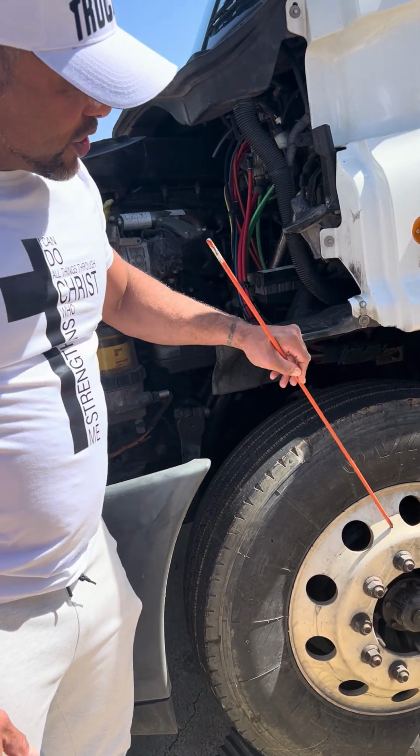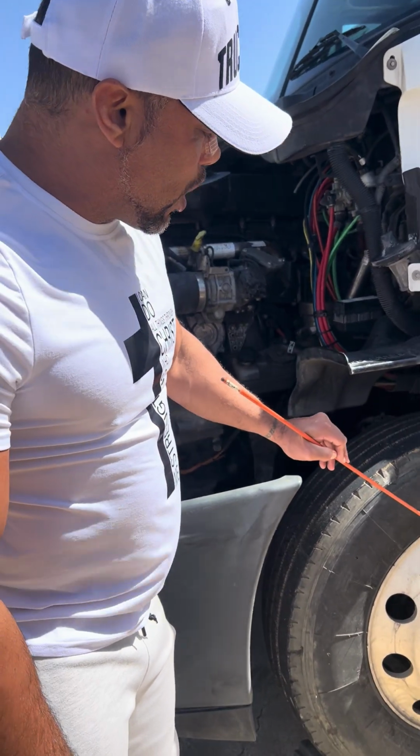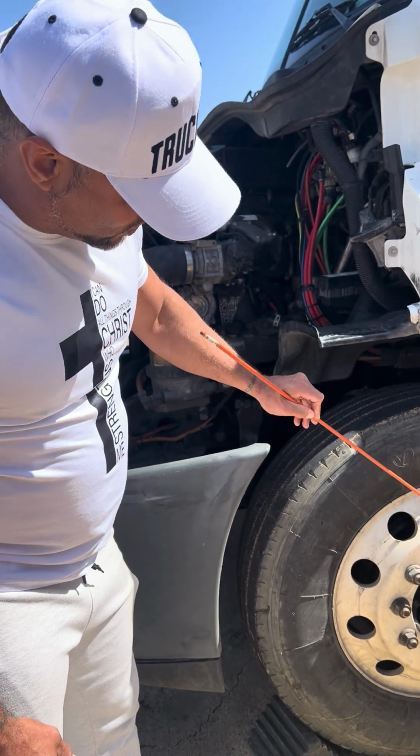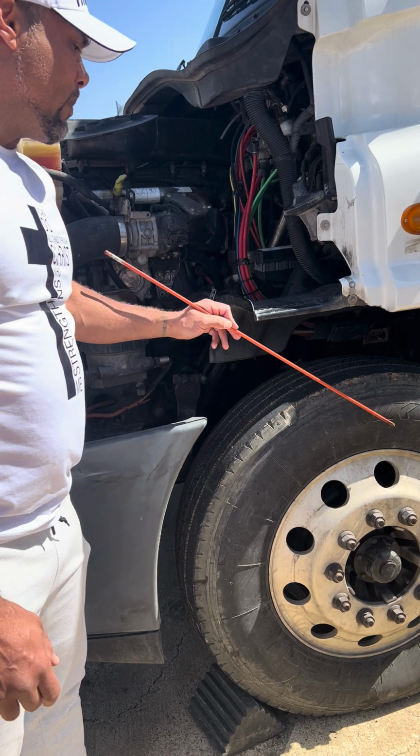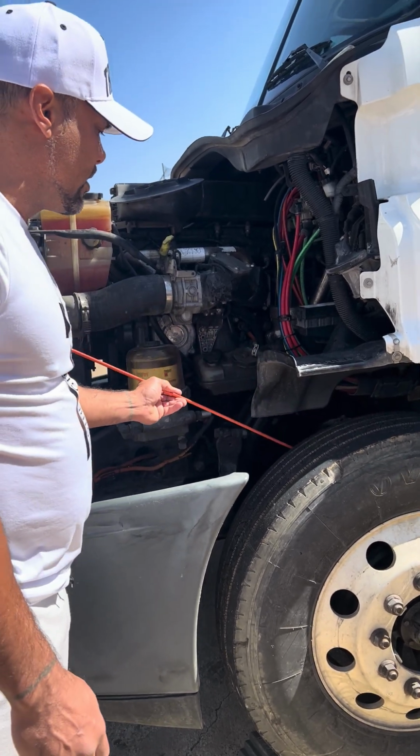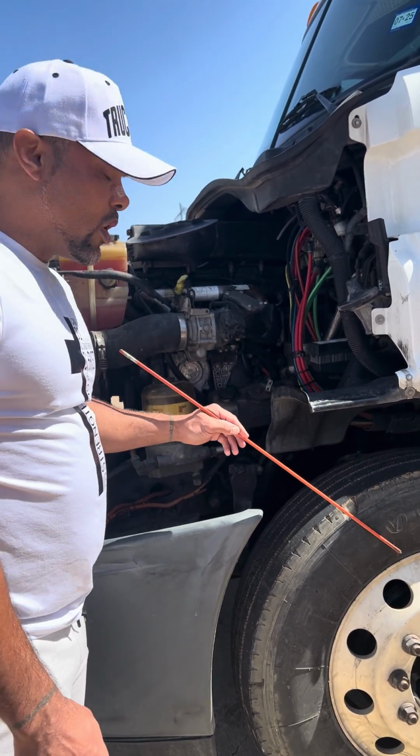Next, I have my rims, my outer rim and my inner rim. They are properly mounted, secured, not bent, broken, or cracked. All nuts and bolts are present and tight. No illegal welds. Properly seated to my tire, which is also properly mounted, secured, not bent, broken, or cracked. No abrasions, bubble cuts, or dry rots.